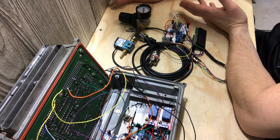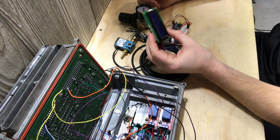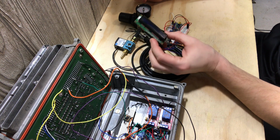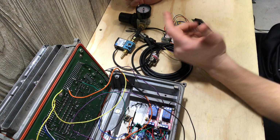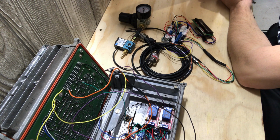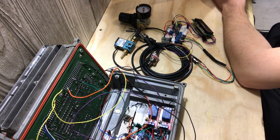The gauges and that stuff is not that hard, because the J1850 goes to the Arduino, and then you see the Arduino output to these 16x2 I2C board LCDs, which is pretty simple. I've already proven that, and I actually have my gauges dummy tested to where I have everything written out, like trans temp, oil temp, oil pressure, fuel pressure, volts wouldn't be that hard.